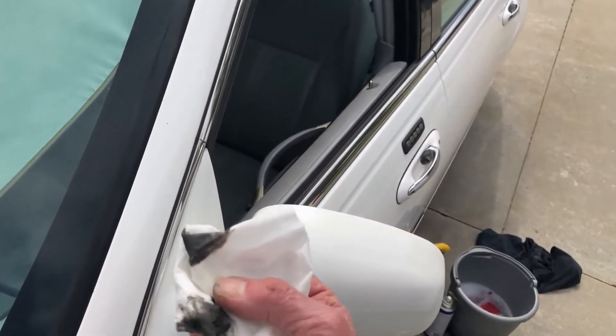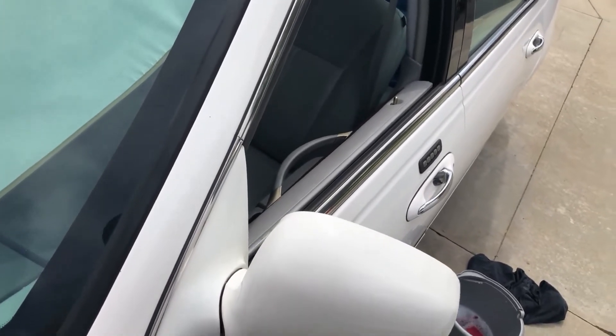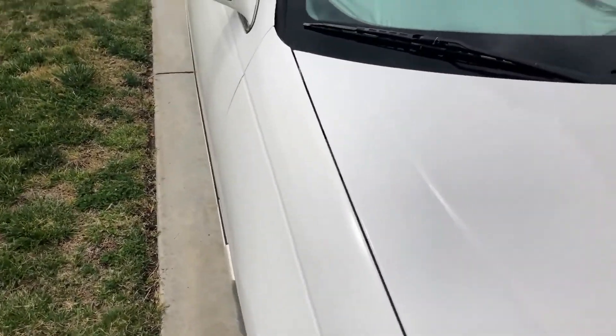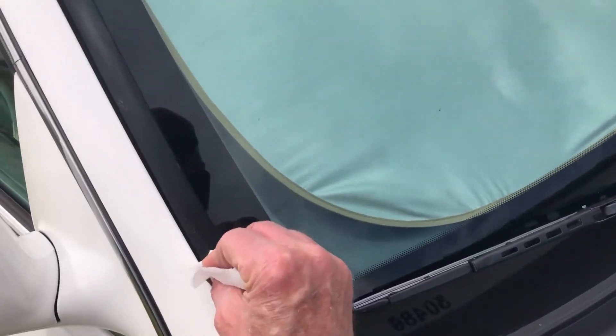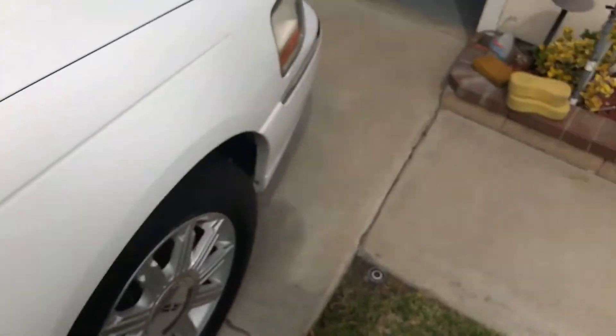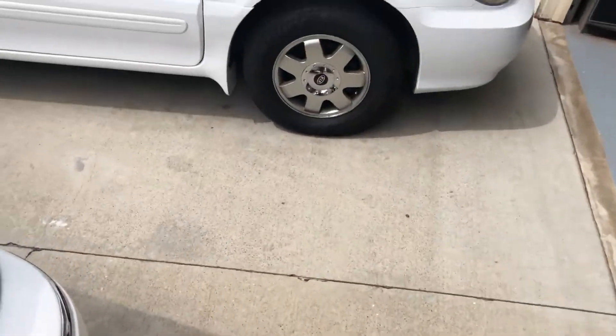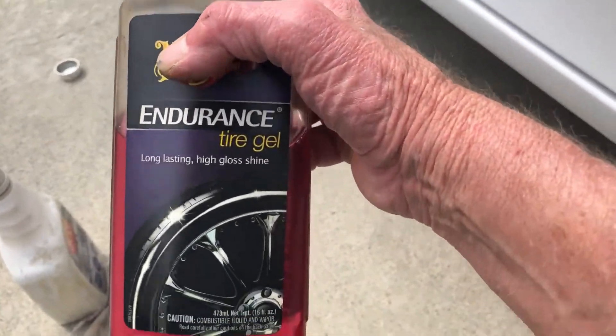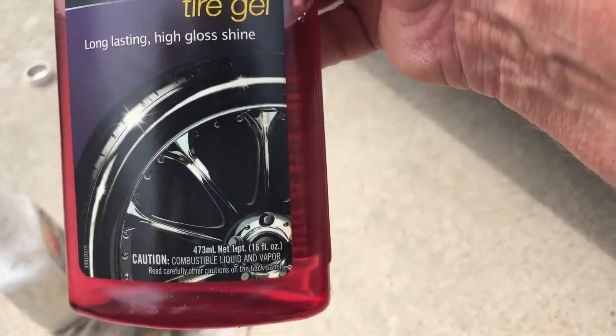This takes off just a tiny little layer of the rubber. And then I apply pretty much 100% silicone from Mothers. You can see kind of uneven little white spots on here. This car was left outside — it lived outside — so a lot of these seals are starting to dry up. This stuff right here is silicone. It's really thick.